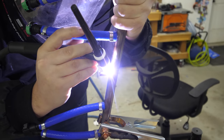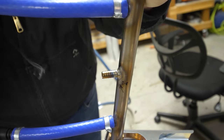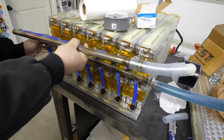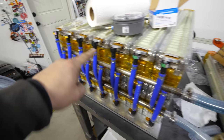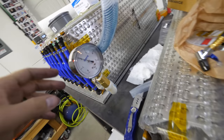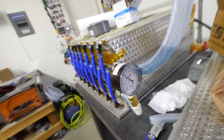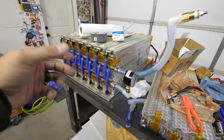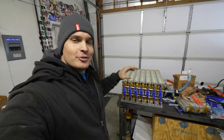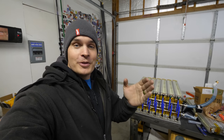Melting the metal back together seals the hole, allowing us to put the manifold back into place to be re-pressurized. We finally have everything connected back up and re-pressurized, sitting just shy of 2 psi. We'll see if there are any more leaks — if this stays solid, we're good to throw it in a box and put it in the Humvee. After 24 hours it's maintained its pressure, which means we've found all the leaks.